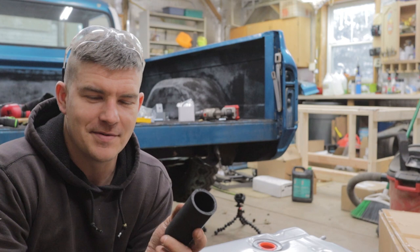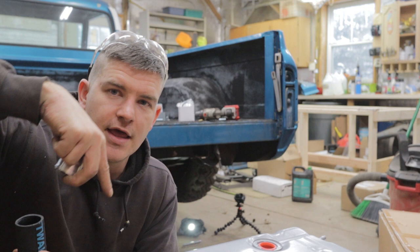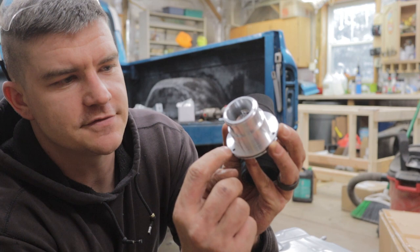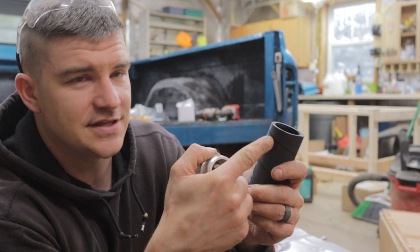And we'll be able to find the dead center of that and poke a 1/8 hole with a drill bit through there, and that'll transfer the center of our circle to the top of the bed, and we'll be able to duplicate the circle and drill from the top. I don't know if you can see on the back side there, there's fasteners. It has to be a very precise hole. There's only probably 1/8 inch of air built into this thing. Now there's a little bit of wiggle room with this tube, but you can't count on it.